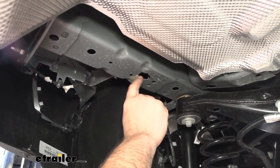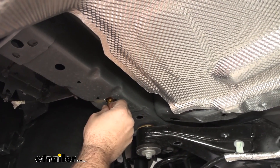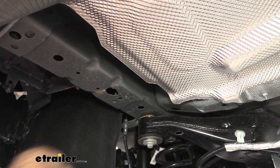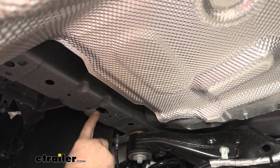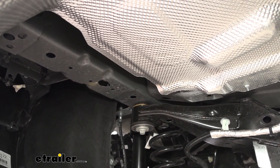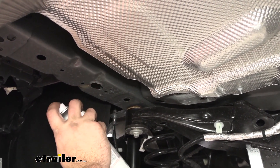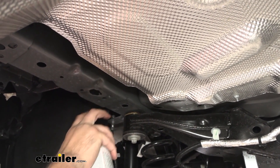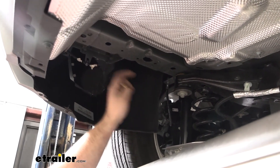In addition to lengthening the hole, I also widened it so the head of the carriage bolt can go in. I've found it's best to angle the bolt in — no worries about solid contact because the spacer block will also go up here and create a nice mounting point. Make sure both sides can accept the hardware. After enlarging, apply a little spray paint to the raw metal edges to protect them from rust or corrosion.